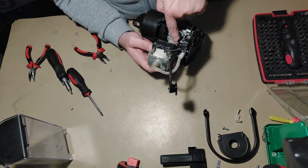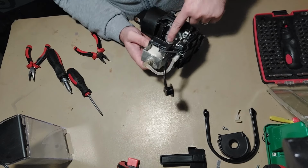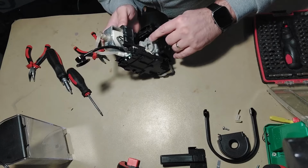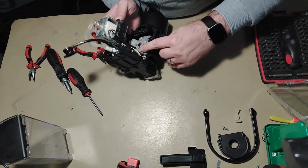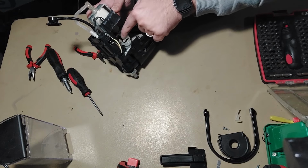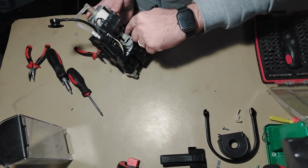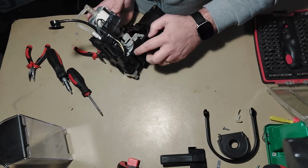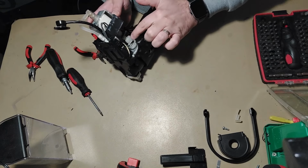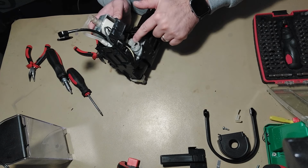If you have water here, if it's wet over here, let's see if you can see it. So this is the U shape, and inside of this you have two gaskets. If it's wet here, then you can change these and you will not have leakage. As I said, I will cover only the cold water leakage first.